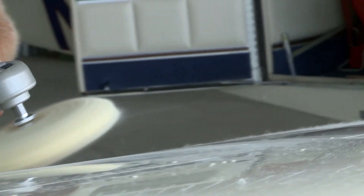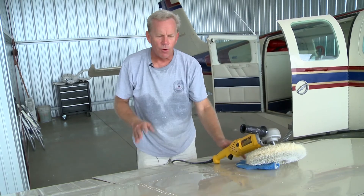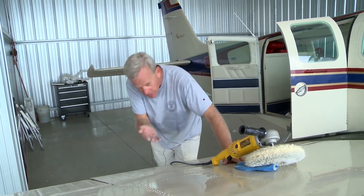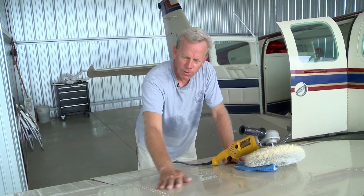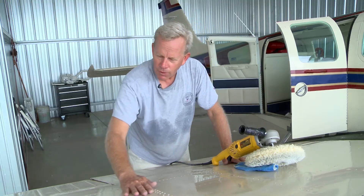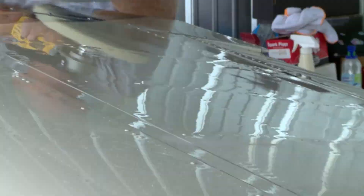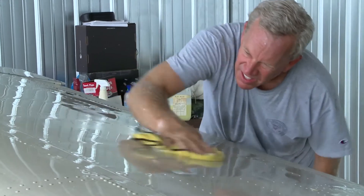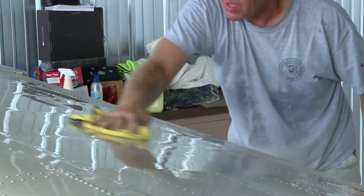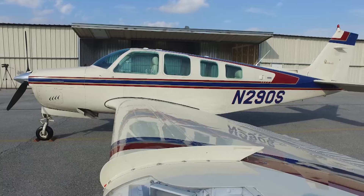Work it back and forth. Take a quick break and look at your surface. What's really helpful is to have some ambient light that can reflect and show how much oxidation was removed on the first pass. This actually did a pretty good cut — now when you run your hand across, there's hardly any friction sound whatsoever. Once the cutting process removed the oxidation, we went back over the airplane with a polishing compound and a foam pad. The process is topped off with some wax to bring back more shine and to protect the paint. It takes a lot of elbow grease, but all that hard work will leave your airplane looking shinier than it has in years.